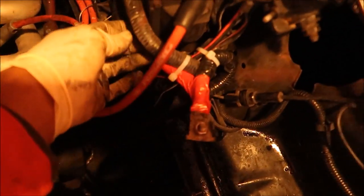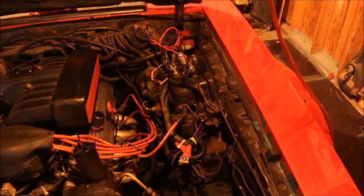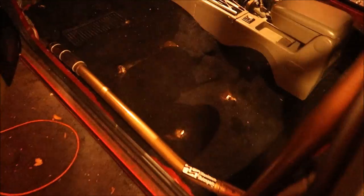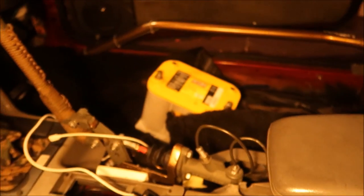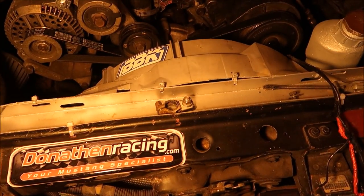What I've got here is a long power wire — a zero gauge wire going straight from here to the positive terminal on the battery, connected to where the positive terminal used to be. It comes from the driver's footwell, runs along the carpet on the inside since I pulled all the carpet up, and pops out right here to connect to the positive terminal on the battery, which is going to mount further back. I'm going to reuse the terminal that I already had and hook that to the battery and cable.